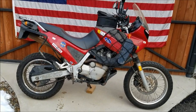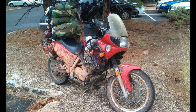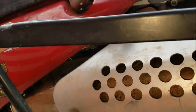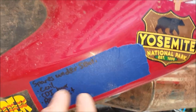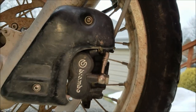That's the bike — here's a quick picture of what it looks like loaded down for my trips. This is a great all-around adventure bike right here. Reliability: you've got carburetors, no fuel injection. Adjustable rear suspension — the shocks are okay. I added a fuel filter in case you get debris inside the tank, and there's a 12-volt charger right there. I keep spare components under the seat with a list so I don't have to check before a trip what's there. I also added stainless steel brake lines because the factory one started leaking. You've got a Brembo dual-piston caliper in the front.